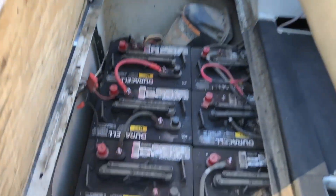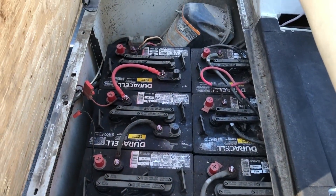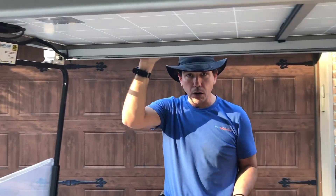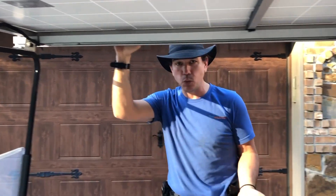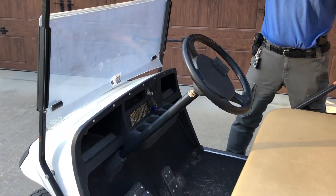Our batteries on this cart are just your standard, relatively cheap Duracell batteries. But because I'm not putting them on a heavy household charger — I'm giving them a nice solar trickle charge every day — my batteries need less water and are experiencing drastically less wear. Other than the ride up in the morning, they're recharged by lunch, so it's really a neat process.